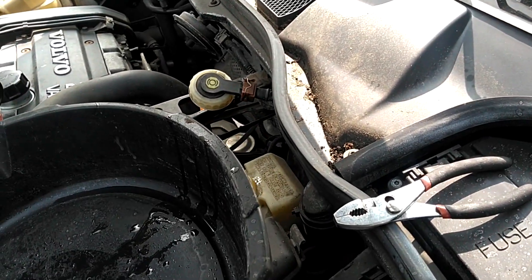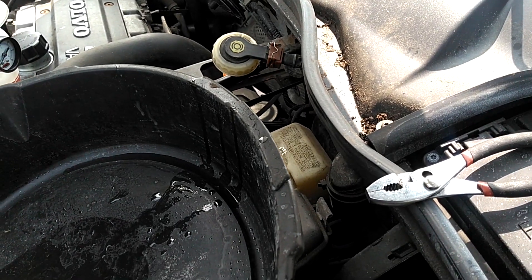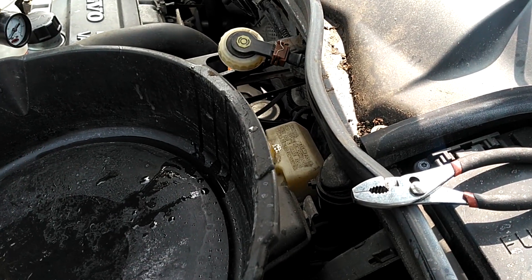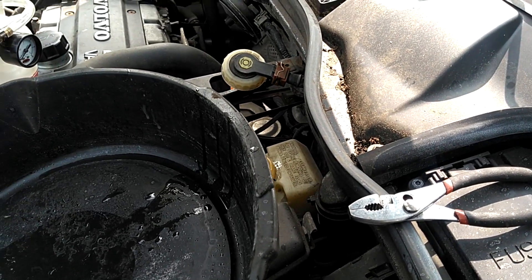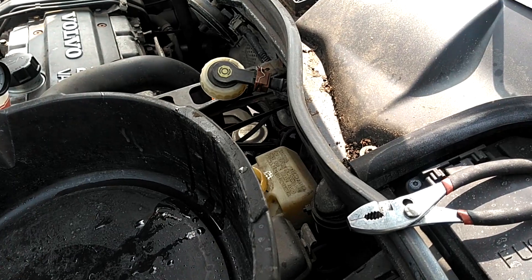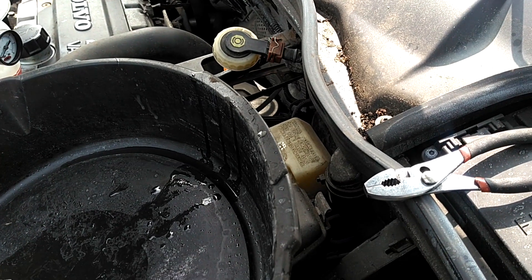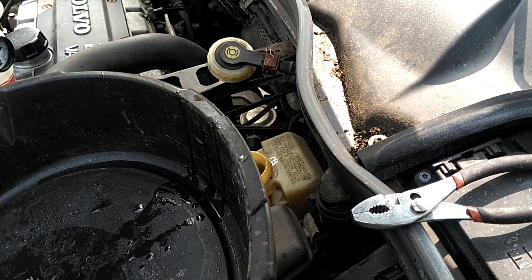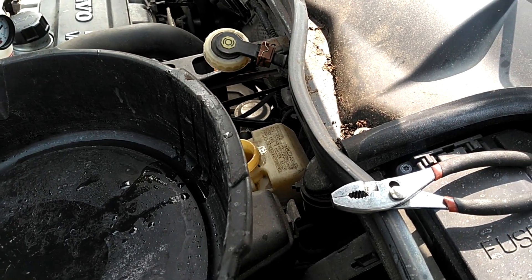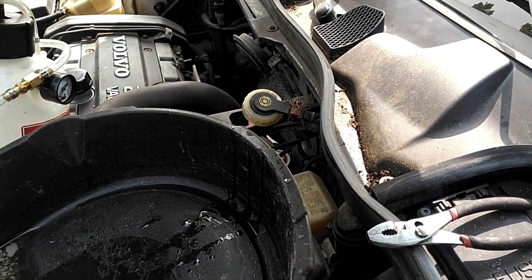In this video, we're going to show you how to bleed the brake system — that is, replacing all the fluid in the entire brake system, from the reservoir back to the calipers. You also want to get all of the trapped air out of the system, because air in the system can cause the brakes not to be as efficient. Air compresses, while fluid does not. This is really something you should probably do every two years or 30,000 miles.